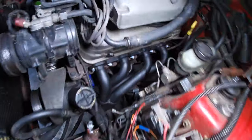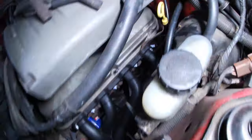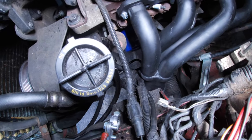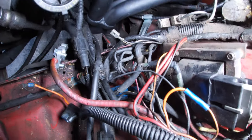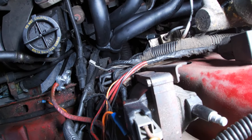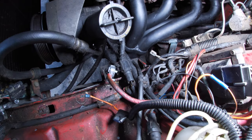We got the driver's side header slightly on - just one bolt in the front and one half-assed bolt in the back. The smaller oil filter is coming in handy, which was a good tip from one of the Fox Body guys I check out on YouTube. The clutch cable bracket I had to slightly bend back because it was literally right up against the header blocking its path. I'm most likely going to need to wrap that area with heat wrap later on.